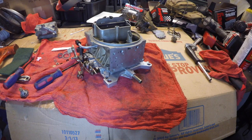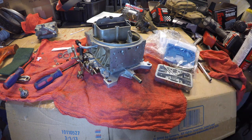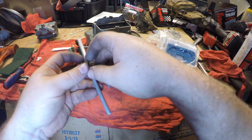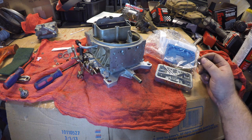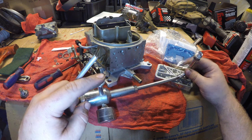So I've ordered this kit. The kit comes with Holley bolts, gaskets, instructions, another plate, and this particular kit comes with another tube. That tube is useful if you're using the 4150 style that has the external crossover, but this one relies on this tube right here. It transfers the fuel in from the pump directly to each bowl.